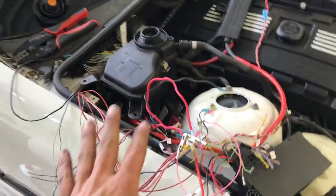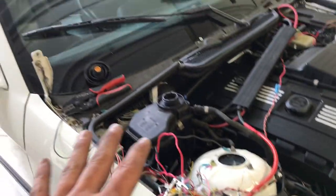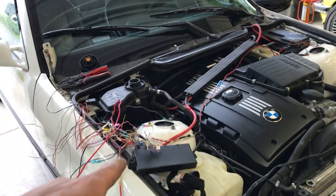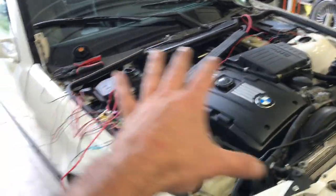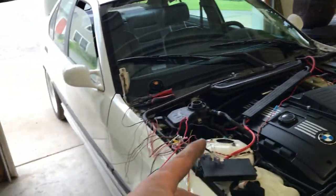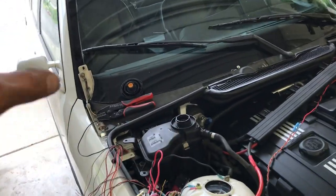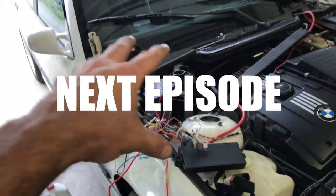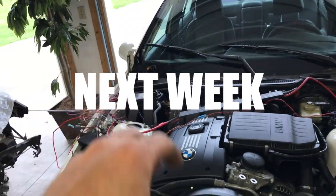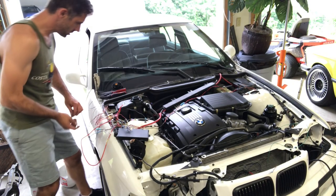What I did was I basically consolidated a lot of the wiring with the existing stock N54 and CAS. So I'm going to start it up and just make sure that it runs and idles, and then I'm going to fill it up with coolant and I'm going to see if I can rock this thing back and forth, move it around. This is the first time we're actually moving this thing on its own power since I just bled the clutch and I can actually control it. I think that this will work out, but we'll see. I'm very excited. After we get that working and we bleed the system of coolant, we're going to end up going into a rewiring and we're going to do an unboxing of the Kassel N54 MSD81 DME. It'll be very exciting. Let's see if we can get this thing running. So let's do a quick test start.